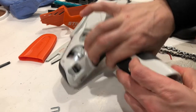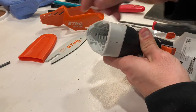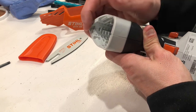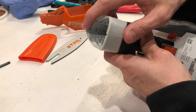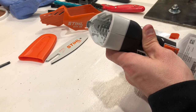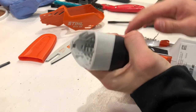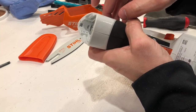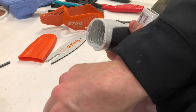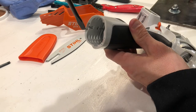Now that I've got that together, I want to show you here on the battery end — if you're looking to take apart this tool — they have little C-clips, just like this, that hold the two cases together. They go in this slot here like that, and then you press them down into place. So if you're trying to get it apart, you would need to take your screwdriver down into here and pry it up and out like that. I just tapped it literally in there with the bottom of my screwdriver and I was done. Same thing on the other side of the battery opening — just slide in the other clip and then it'll go down into place. I'll just seat that here with the screwdriver end.